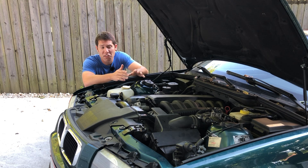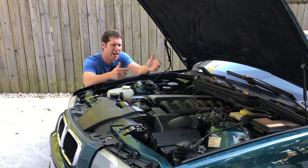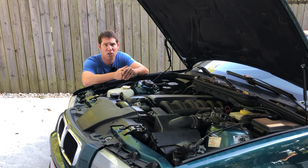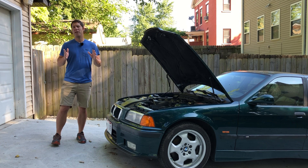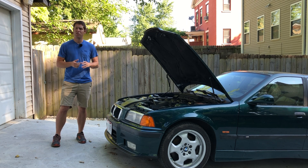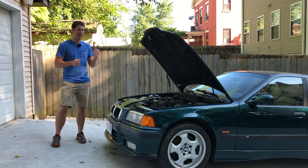The other problem has to do with this glorious and not at all underpowered inline-six engine. There's something going on with the air-fuel mixture, and it's just making the car run rough at idle when it's cold. When it warms up it runs just fine, but when you start it cold, it sounds like this. I've already replaced one of the main vacuum lines in the emission system, and I've also swapped out the mass airflow sensor for a new unit, but obviously neither of those has fixed the problem because I'm still having a rough idle.